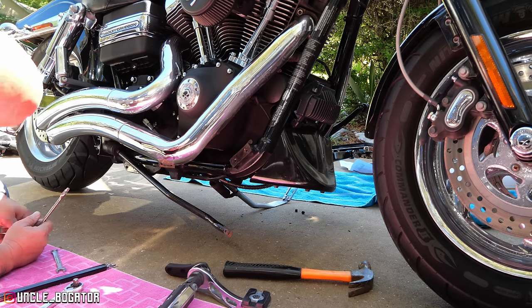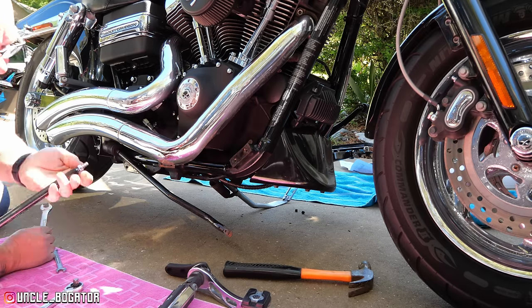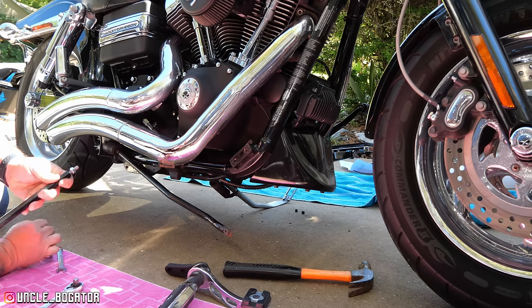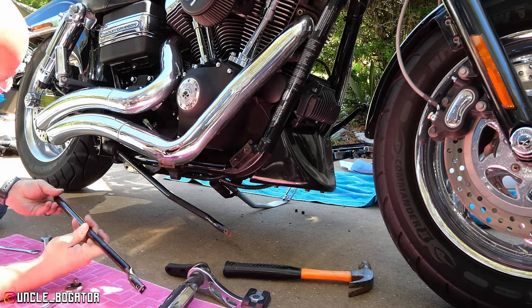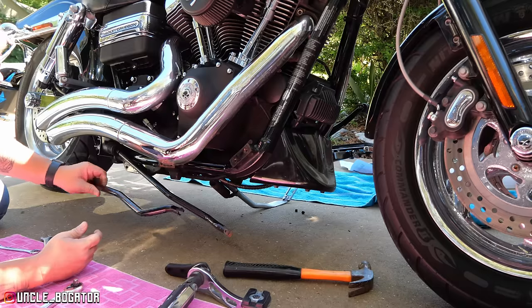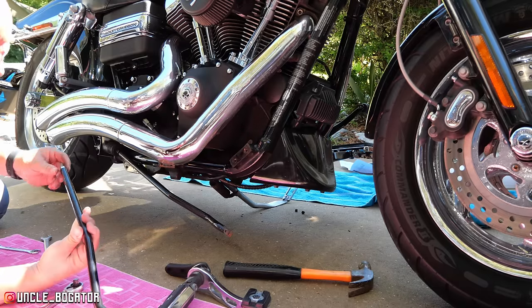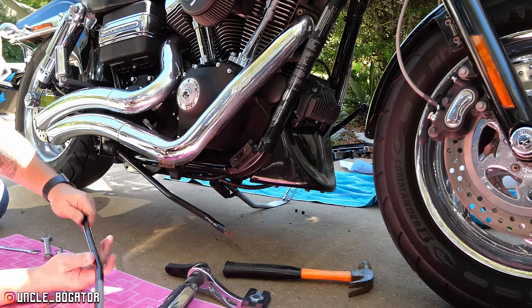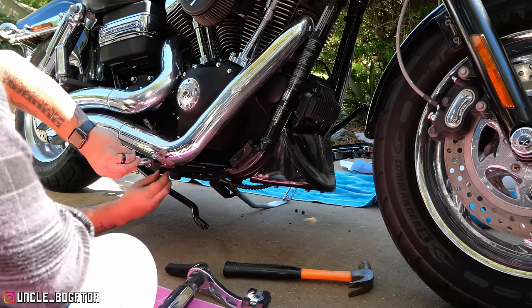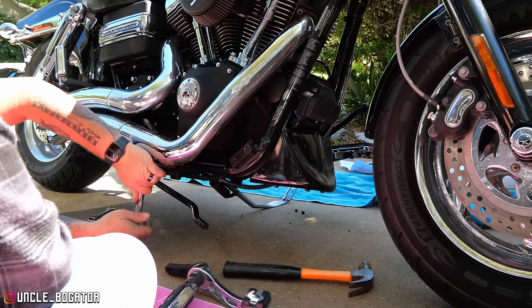Do you know how, by looking at this, this whole operation works? Like what this is for and all that? No. So what happens is you're going to screw this in, and you're going to bring it all the way back here. Screw it in, and once you get this perfectly lined up with your brake pedal, then you run this nut down as a lock nut to tighten it. Gotcha. So all I want to do here is just make sure I can run these in. That's where I messed up earlier.